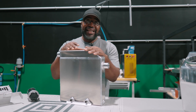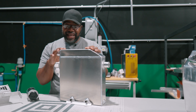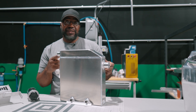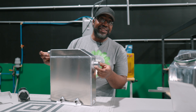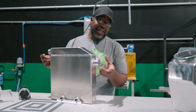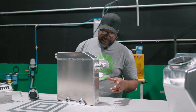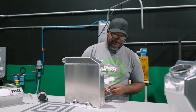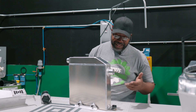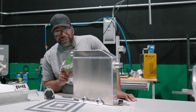These are typically mounted inside the car towards the rear. You have an inlet and an outlet. This one can be configured with AN or ORB fittings, and this one is actually set up for standardized hose like inch and a half standard ID hose. They're also equipped with a stainless ball valve for draining that normally installs right here for reference.